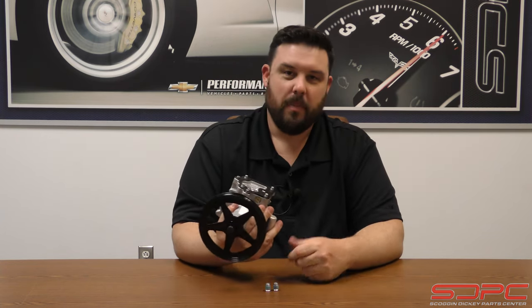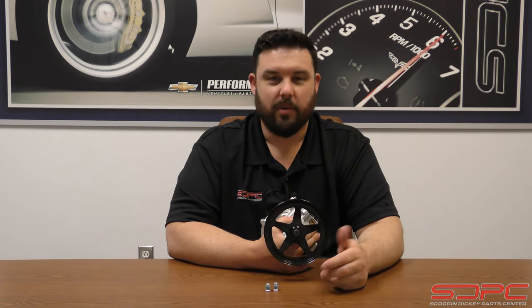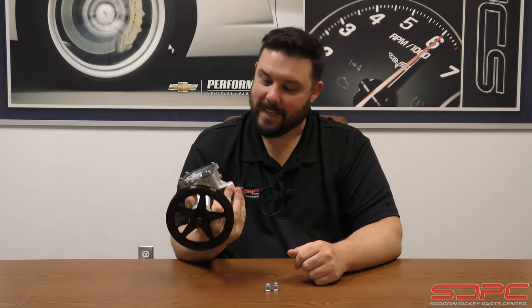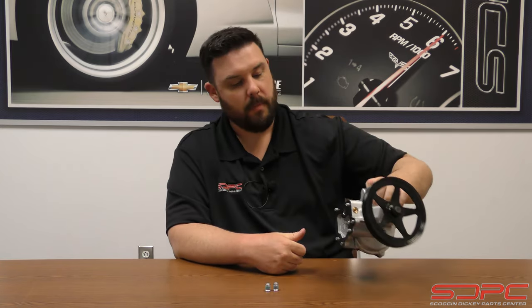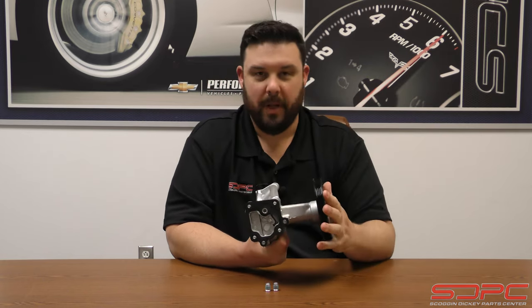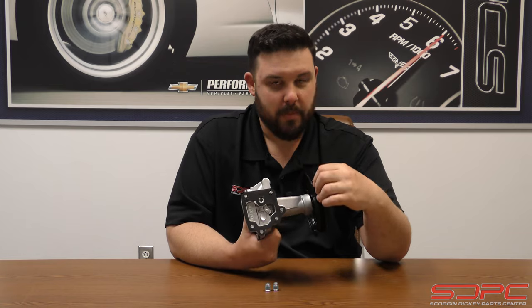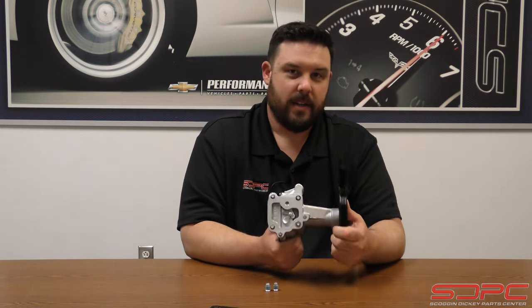How do you get rid of this thing? Most of y'all might be watching this because you went to a junkyard and picked up an L83 or an L86 — the truck engines, the 5.3 and 6.2. They're great engines and they're turning out to be really popular for swaps. They are definitely the next LS platform as the aftermarket is starting to catch up. Direct injection is a good thing. They are a little bit more expensive to swap, but they're the way to go. But then you grab this pump — you're trying to put it in a car, put engine mounts on, and you're going, golly, this thing is in the way. I'm doing a DOD delete anyway, I don't need this thing. Well, we're here to show you how to get rid of this. It is as simple as unbolting it from the engine and removing the belt. It is a stretch belt and is not part of the rest of the accessory drive. This tiny little three-rib belt goes to its own independent pulley on the balancer with no tensioner or brackets. Real simple — cut that belt off, remove four bolts, and of course the gasket. Take this thing off and chuck it in the bin.